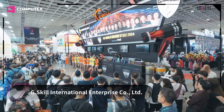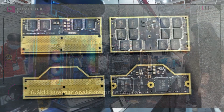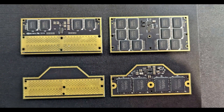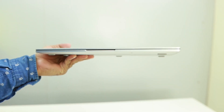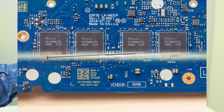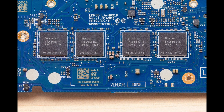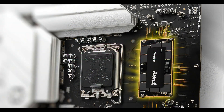What's up, guys? Charles here. The days of sticks of RAM may be coming to an end. A new standard, CAMM2 — Compression Attached Memory Module — is starting to take off. It allows for faster speeds and for smaller modules to fit in tighter spaces, allowing thin laptops to be more repairable or upgradeable. Recently, many of the biggest PC vendors have soldered RAM to the motherboard to save space in laptops rather than using SODIMMs, so CAMM2 can help there. But this new memory is popping up in desktops too, with its own unique benefits. Here's what you need to know about CAMM2 and LPCAMM2.